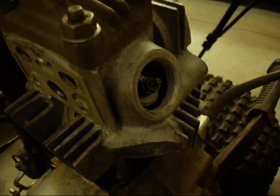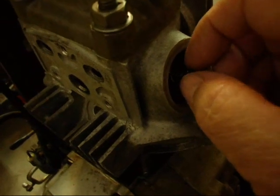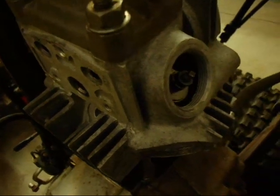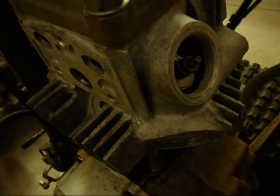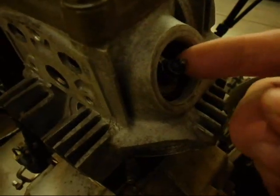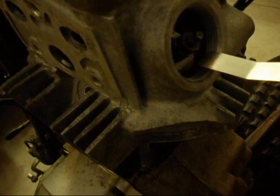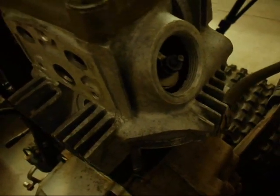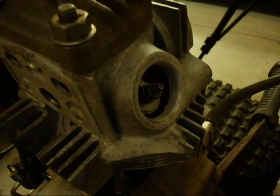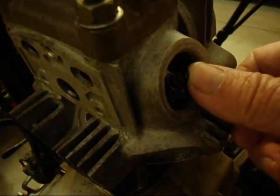Now we're ready to set the valve clearance. The first thing you do is loosen up this nut here — it's a locking nut, nine millimeters. You'll adjust it by turning the square adjusting screw down to where it almost touches the valve. You'll check it with the feeler gauge — it's set at seven hundredths of a millimeter or three thousandths of an inch, which is really thin like a piece of paper. When you set it in there, the feeler gauge will go in underneath and there'll be maybe a little tiny bit of drag, but it will go in. After you tighten up the lock nut, you want to recheck it because sometimes just tightening the lock nut will turn it down a little bit. You can also listen to the noise, because you can set it up pretty close by just knowing how it's supposed to sound.